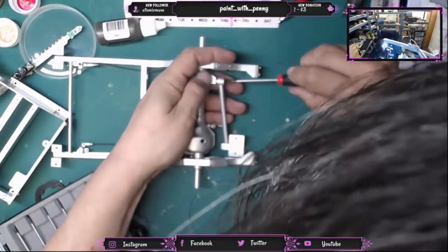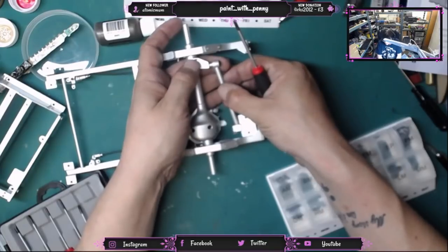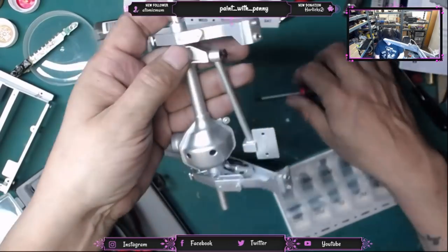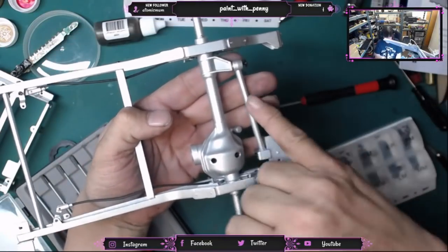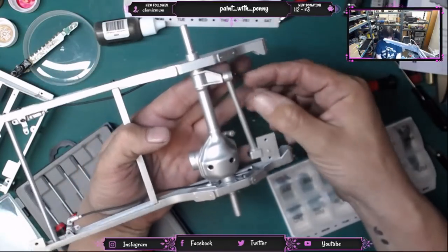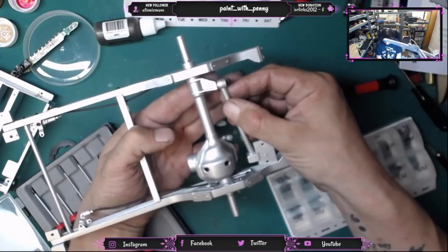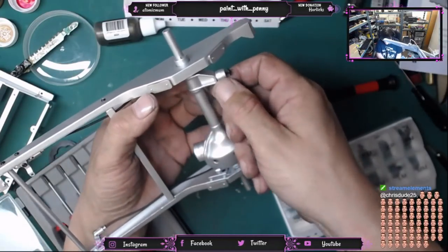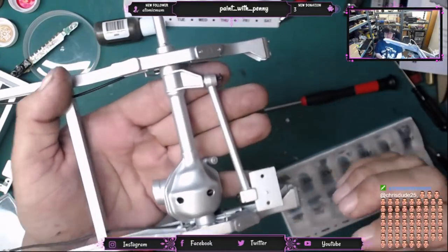It is a self-tapping screw. So pop that in carefully, don't over tighten. And what I've done is I've fixed it because there's a bit of an optical illusion here. Because that trailing arm is coming out at an angle, it makes the screw look like it's not actually in straight. But if you just pull it backwards and forwards, you can clearly see it is straight. So just be aware, it kind of plays with your eyes a bit. Once you're confident, then pop that in until it catches, but don't over tighten.